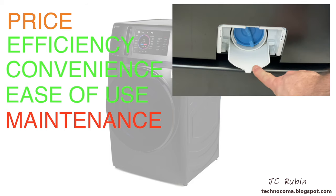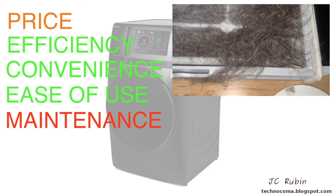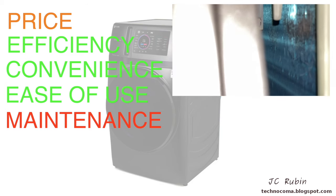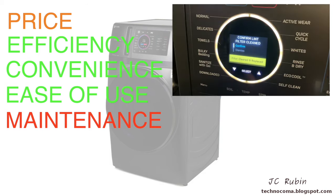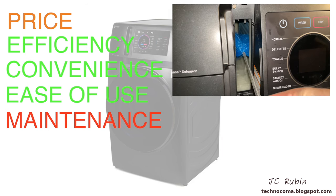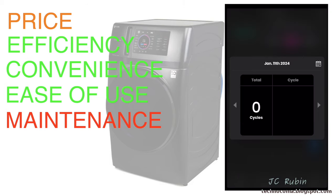While the washer filter is straightforward, unfortunately the dryer filter leaves a lot to be desired. I feel like before long the heat pump is going to be clogged. I generally don't recommend extended warranties, but if you're not the kind of person who can repair this equipment yourself, I do recommend looking into that possibility. Before long, I believe drying times are going to increase and eventually the heat pump will need to be cleaned out. I do hope GE provides some sort of fix for this filter problem — and at least if they provided decent analytics you could track heat pump performance over time.